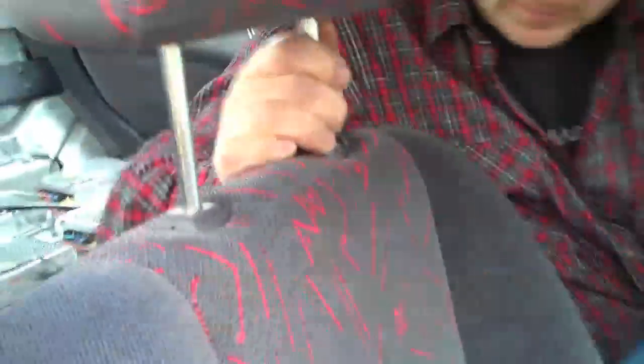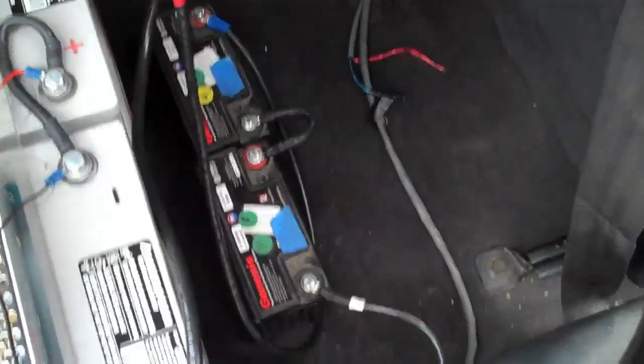Back here behind the seat, I've got two little 13 amp-hour batteries wired in series with the rest of the batteries, but I've got a choice. I can run straight through the battery pack normally, or I can move this connector over and run through the extra two batteries into the battery pack. So when the controller shuts down and I run out of power, I move that over and I've got enough juice to go another mile or two and get to where I'm going or get home. So I've got a reserve gas tank now.